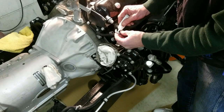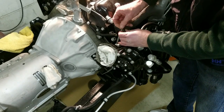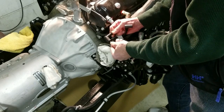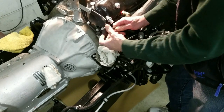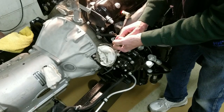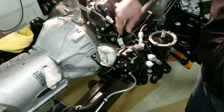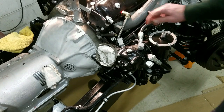They'll look like that when you get them done - a good crimp. Then I put quite a bit of that silicone on there because you've got to pull it through the boot and you don't want to bend things up. I get some silicone on it, get it started the right way, and then go ahead and pull them through, maybe get stuck a little, and pull them right into the boot. That's how I do them - I pre-measure them so I don't have a lot of slop.